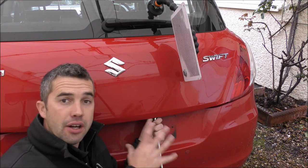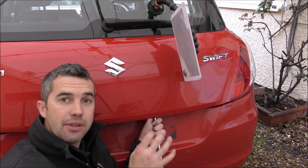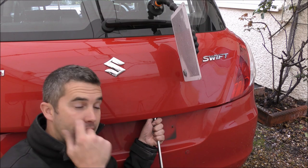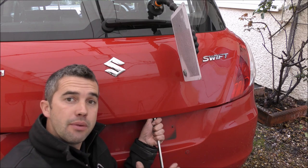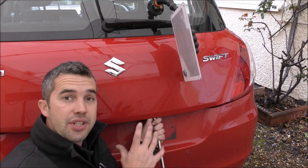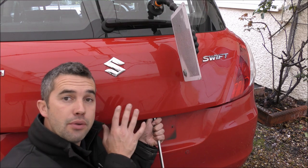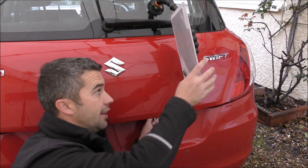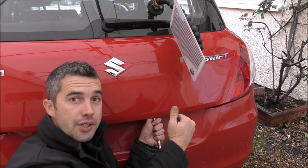load of lows and highs, and then moving to the next point, line board, and then taking out the lows and the highs. And it's the most important thing, as always with every dent, but even more so with the large damage, is to cross-check your work constantly. So I'm working out the lows and the highs I can see from one angle, and then just a slight adjustment on the board, and then work out the lows and highs from that angle.